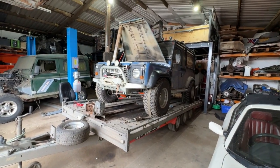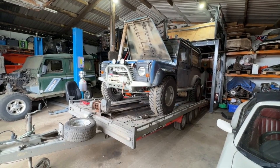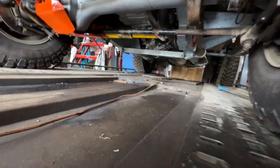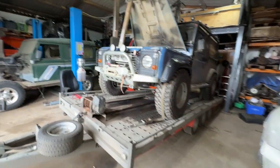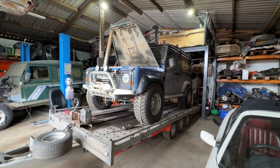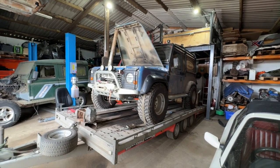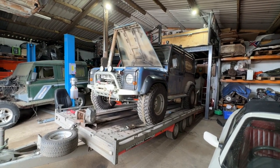The second alternator has just stopped charging. So fix one thing and something else comes along. I was about to say I don't think we've had another oil leak, but I don't know if that's old or new — keep an eye on that. A couple of the sump bolts were loose, so I've tightened them back up. We'll keep an eye on that. Now I'm going to quickly take the dash panel off and just check the light on that — the battery light on that charging circuit, because that stopped coming on as well, which makes me wonder whether the bulb is blown.